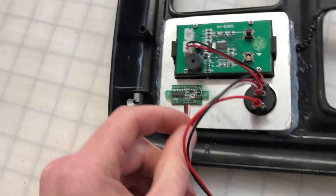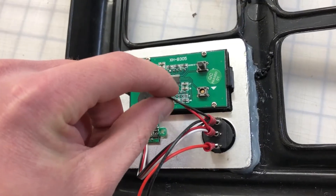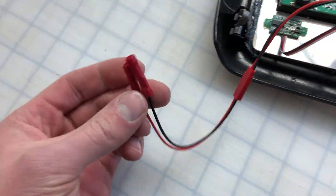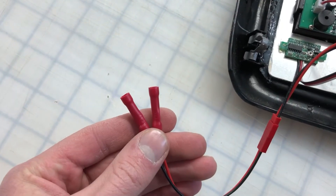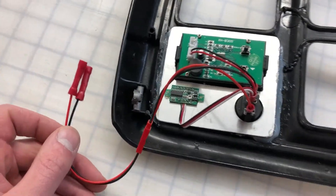Let's take a look at the back. Simple wiring: three leads off this — a negative, a positive, and a read — then just negative and positive for the temperature meter, all going into crimp connectors on the back of the switch, leading to a connector. I have butt connectors ready to go for when I install it. I will have links to all of this in the description.